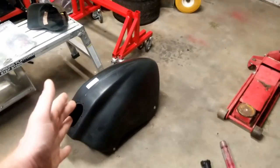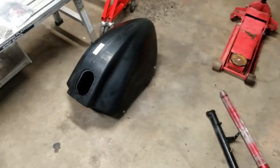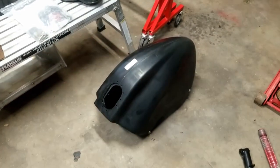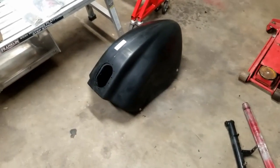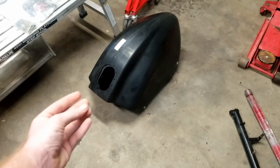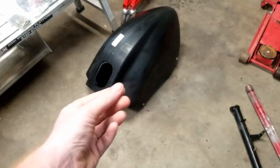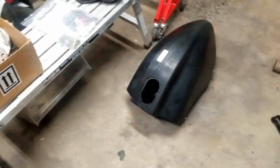We're gonna go ahead and put this together today and fill it up with alcohol all the way, so it pulls all the stuff out of the bladder, and then we're gonna dump that alcohol after a couple days and discard it so we don't clog our fuel filters. Apparently what happens is the alcohol pulls some of the rubber and chemicals out of the bladder — it's like a black soot — and it runs through the fuel system and it'll destroy injectors and stuff.